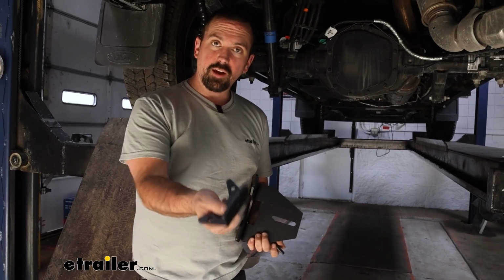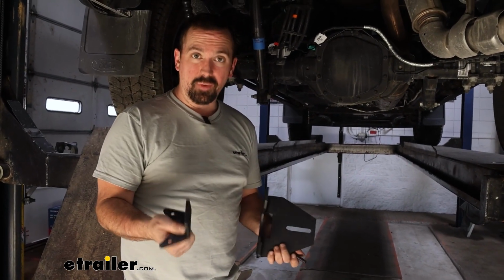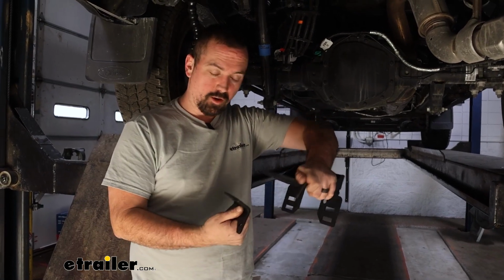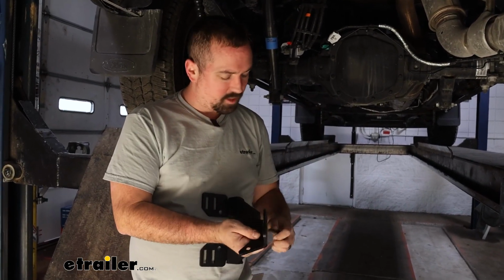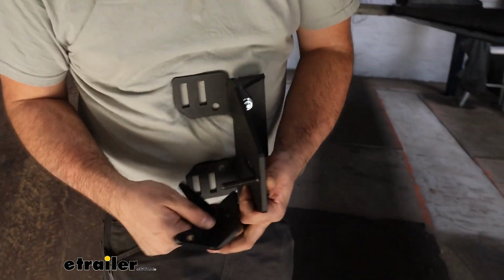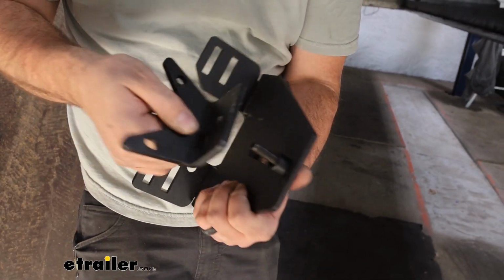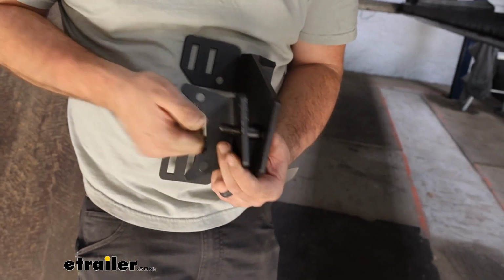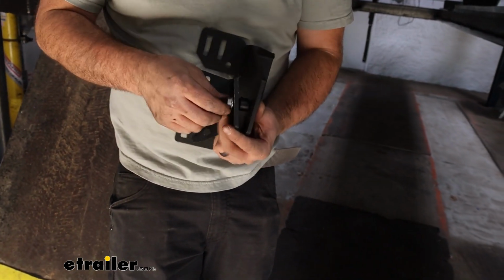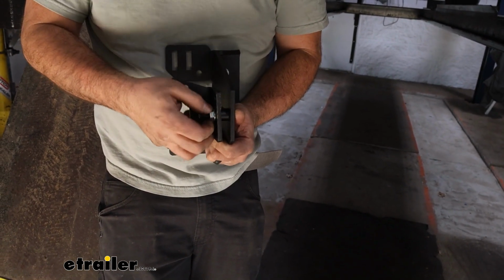With our assembly, we're going to grab the axle bracket, and this is going to rest on the axle, and where the jounce stop is, or the jounce plate, this is going to kind of account for that. It's going to rest on there, but we need to put this in place, and this is going to be a dry fit. So take the cap head screw, it's about a 2-inch here, and we're going to put our 3/8 spacer, which is included in the kit. We're going to start with that. There's a bunch of washers included, and that's to make sure that we get this nice and level. So put your serrated flange nut on here first, and we can kind of dial it in as necessary.